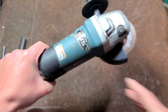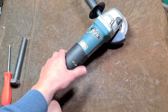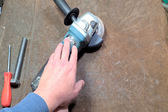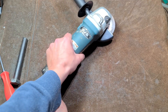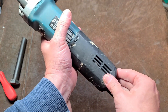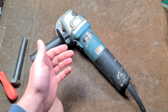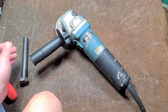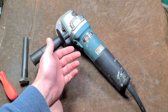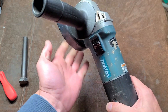This one was made in 2007, so this grinder is already 13 years old — not a ton of hours on it, but it's kicked around and still working great. Makita grinders are generally pretty good. When you have one that's load-sensing with variable speed, a lot of people have used many grinders and what's surprising is what variable speed with decent load sensing can do. When you get a grinder and have the ability to adjust speed across various operations — whether you're sanding, wire brushing, cutting off, working with hardened steels, mild steel, or stainless — you find that you get the job done more quickly, more safely, and more effectively.